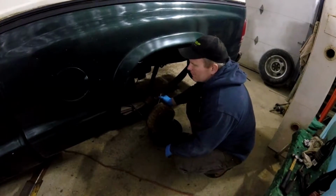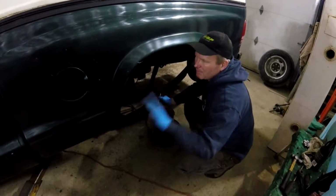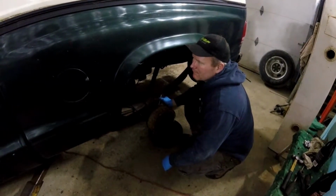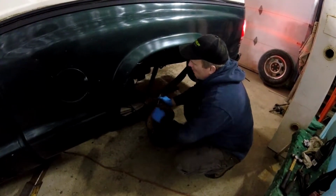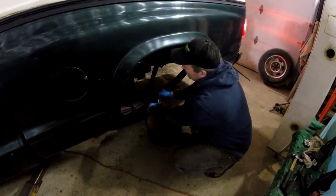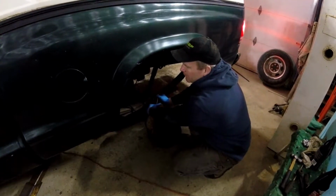Okay, Chad, can you just not pump the brakes? Because that causes little bubbles. Just push it down slowly to the floor, please. Hold it there. Did it go right to the floor? Now I'm going to open this valve up, the little thing. Okay, there's some little noises. Okay, up, just slowly, not too slowly.